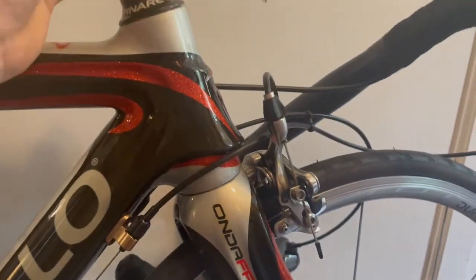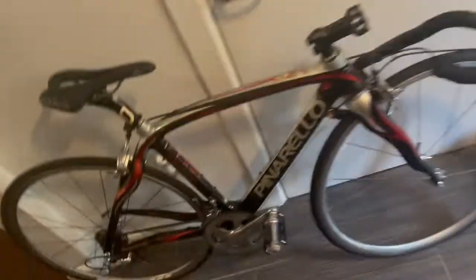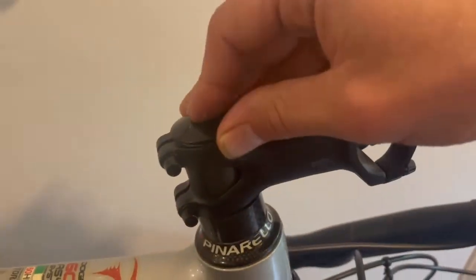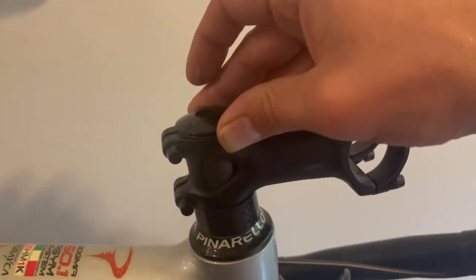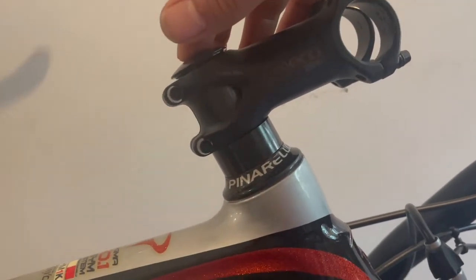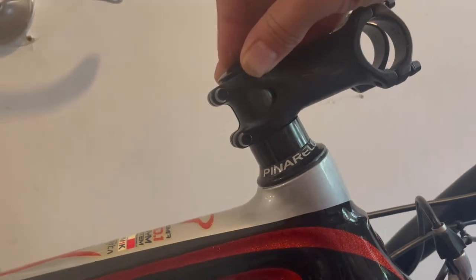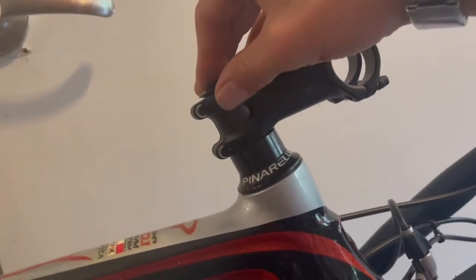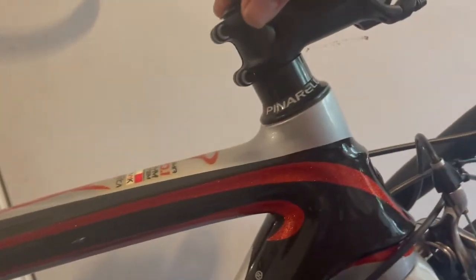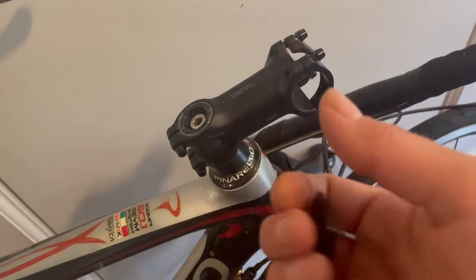It's looking like I actually need to throw a little spacer in there. Be aware of that — if you just pop this on as is and tighten these bolts down, you have no preload on your headset bearings. You're just going to be riding around with a rattling headset and you're going to destroy it. The stem cap is what adjusts the preload of the headset bearings. I'll get back to you guys when I dig around my bags and find a spacer that'll fit.